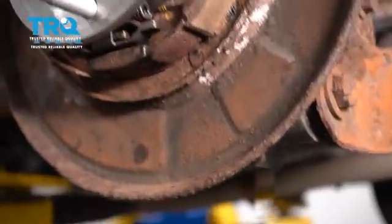Now that the adjuster is greased up, slide it in between the two shoes. Take the top spring — this one is slightly damaged but still holds the pads together properly — and use a screwdriver to expand it and hook it in. Apply some anti-seize to the hub. Using the spray kind, cover the parking brake shoes so you don't get any on the braking material. If you have the brush-on kind, that may work a little better in this situation.